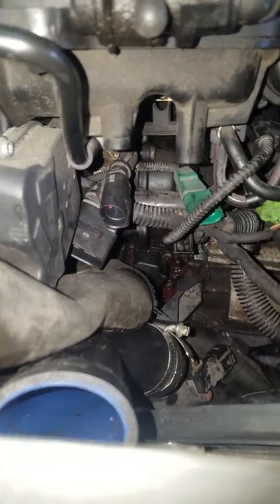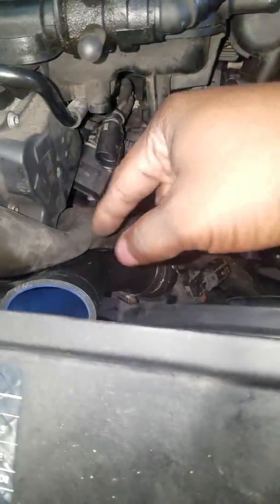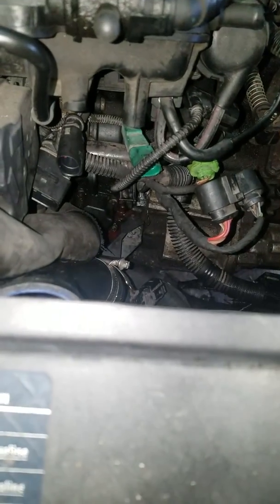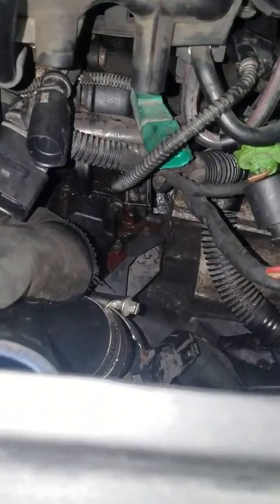There were no tutorials on this, so I pretty much pulled my whole front end off and put it back on, as you can see here. I took my headlights out, fixed a couple of things over there, et cetera. I disconnected the coolant hose as you can see here — I pushed it off to the side so I could have a little more room to get down in there to where the position sensor, or engine speed sensor, is located. Again, it's down in the bottom right-hand corner.